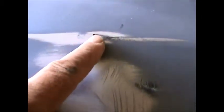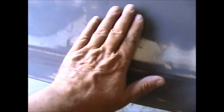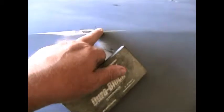Hit this door with 180 grit. I have never bodyworked this door at all. About a year and a half ago I finally got to the doors — knocked down the surface rust with 80 grit and just squirted some old primer on it just to protect it. But as you can see here, it's bondo — or body filler over rust — and right in here there's something going on. It's pretty straight, but there's something going on in here, probably some more body filler. This is right on the body line, so that's going to be a pain.